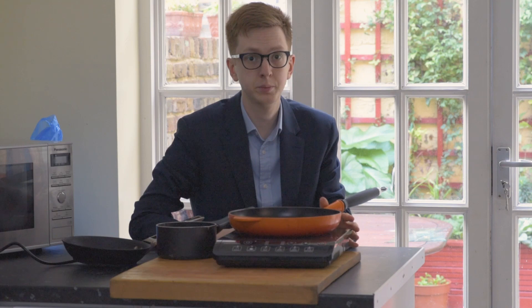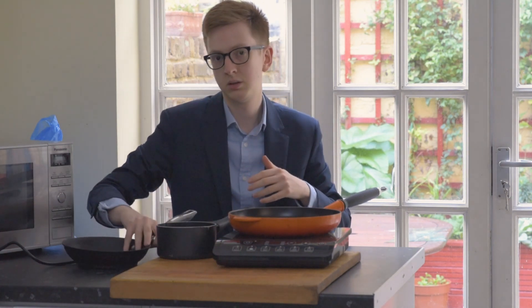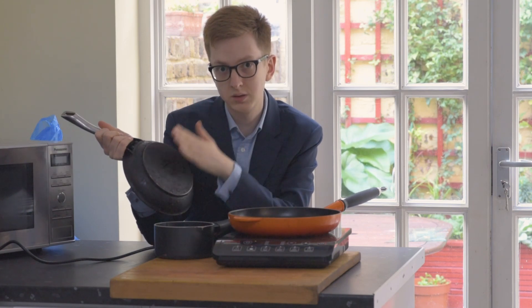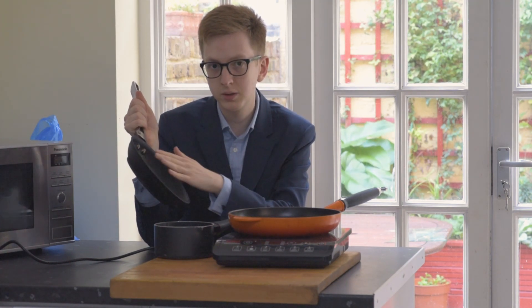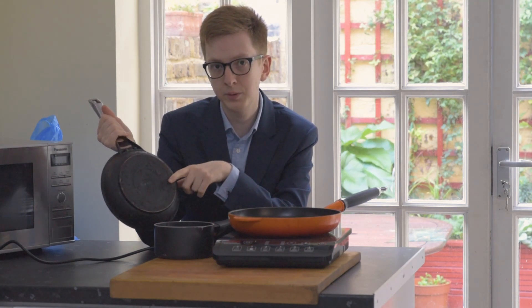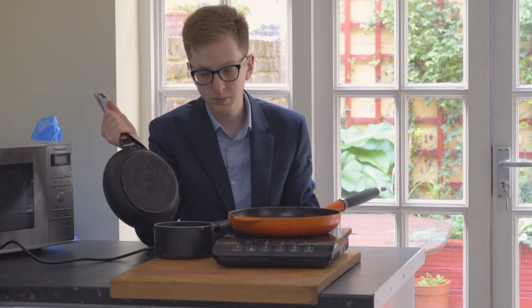When you're out shopping or if you decide to get an induction hob, the only pans that will work are ones with a flat magnetic base, and ones that are generally smooth as well. This is a good example of a pan where, because it's aluminium and aluminium is not magnetic, they've put a steel plate on the bottom. So when you go to cook with it, the steel plate heats up because it's magnetic and the heat spreads into the rest of the pan.